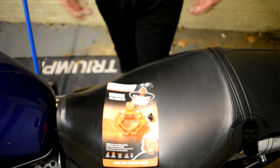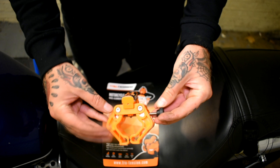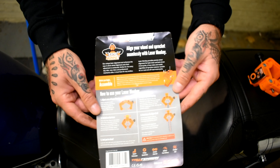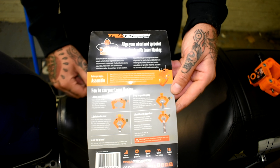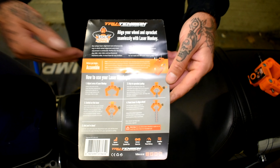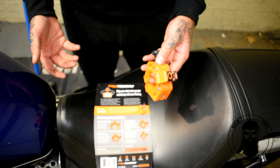So let's just go through the packaging and cut down to my sprocket and I'll show you how to use it. So here we are taking the plastic off it. This is the tool itself. Nothing special. The instructions are on the back, so we're just going to open up, grip it onto the sprocket, shine the beam down the chain, align the chain if necessary. And that is it. It's really easy to use even for an idiot like me.